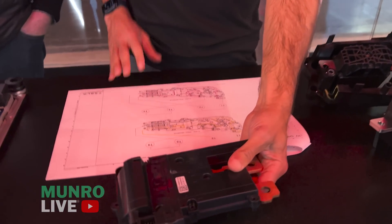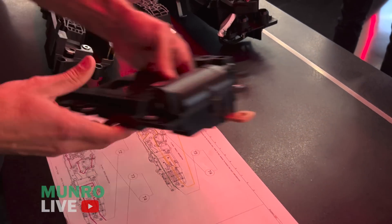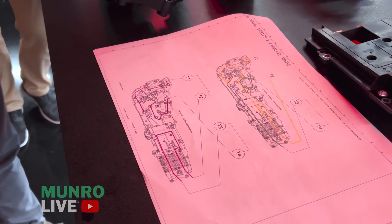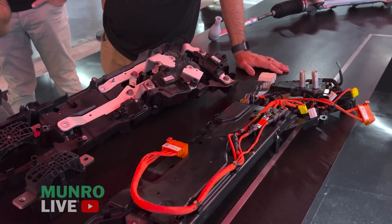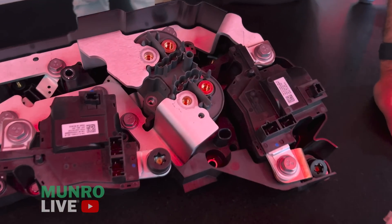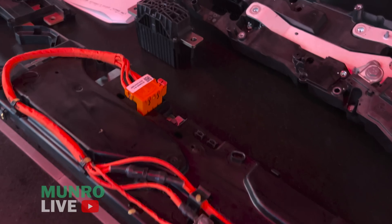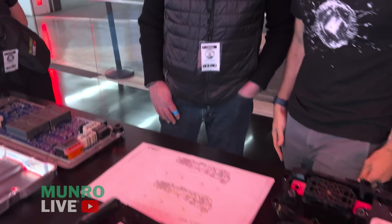One other unique thing in the Cybertruck is we're able to natively charge at both 400 volts and 800 volts. We take the battery and split it in half — since Tesla Superchargers are 400-volt stations, rather than going through a boost converter we directly connect the Supercharger to the battery terminals at either 800 or 400 volts. It's a dual-pole dual-throw reconfiguration of the bus — you can see the bus in parallel and in series. That's happening in the device cluster area of the battery pack where we have the pyro devices, main switches, and this DPDT that configures the bus. All the downstream systems like the power conversion system and HVAC compressor need to work at both voltages, but they're all variable-speed drives with power converters already designed for the higher voltage, so running at the lower voltage is straightforward.